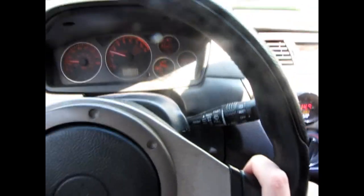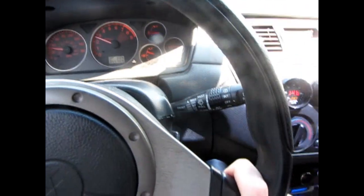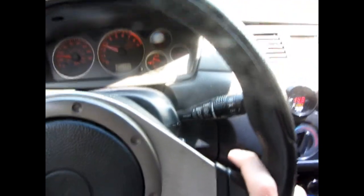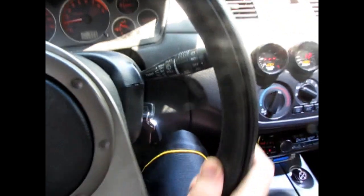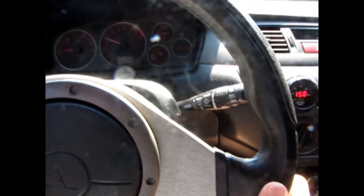When I first loaded, you know, the speed that I see on this car — didn't touch any of the settings or whatever, just did the average map settings. If it had a really lean dip down low, that would cause you to have to rev high to take off smooth from a stop, which is super annoying. I fixed that last night and fixed it so it shifts like butter.